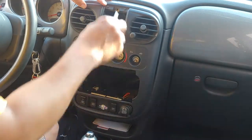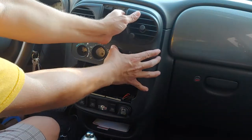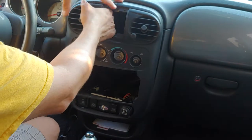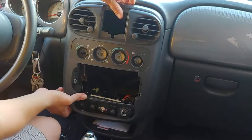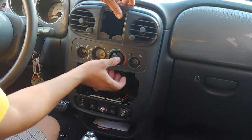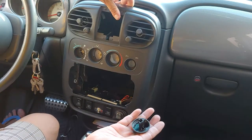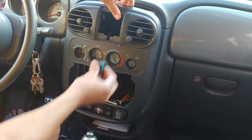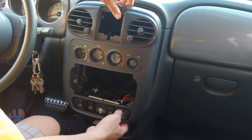Then we're going to take this Phillips screw out. What I do is I go in here, pull this side, and then go in here and pull this corner. These two are going to be off. Then I come down, pop this one out, pop this one out. If you haven't removed these yet, when you pull this out it's just going to pop these out and they'll come out — they'll fall on the floor but won't get damaged. But if you can, remove them prior so you're sure they're not going to get damaged.